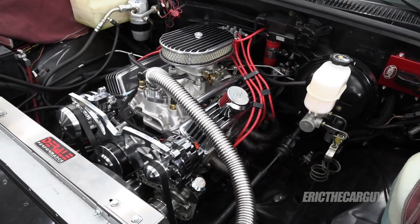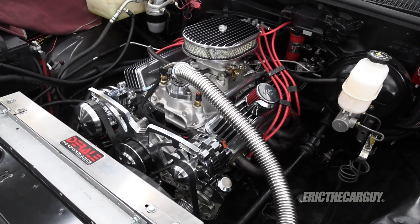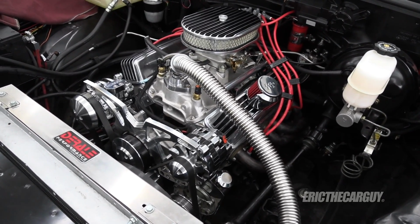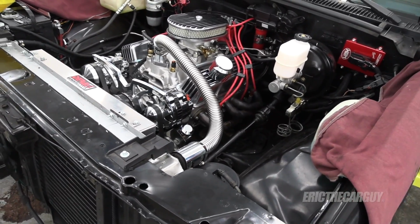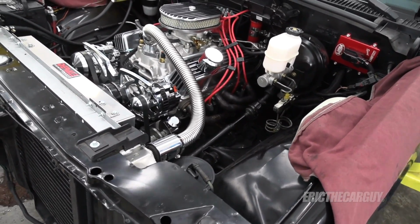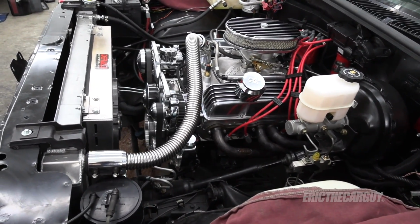First thing I'm gonna do is I have the fuel pump fuse removed, and I'm just gonna crank it over and look to see if I have oil pressure. I did prime it, like I said, but I wasn't able to see if I had oil pressure, but I could feel it. I could feel resistance in the drill when it was turning. So I'm pretty sure it went up through there. Plus I could see evidence that the oil was circulating.